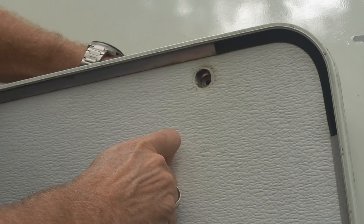Now it's just a matter of figuring out whether we need to stay flat with it or use the bent bar. We can figure that out by comparing it to the other side. On this side there's about a finger's-width gap between the metal piece and the door, which means when the door is fully closed there's a little lip. The flat piece will be a little too little, so we're going to go with the bent bar, oriented so it goes out a little bit. Let's get this nut on there to hold the whole thing in place.